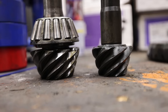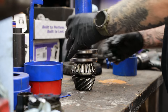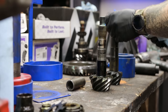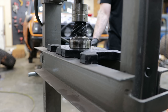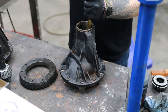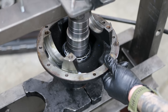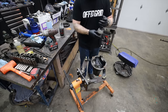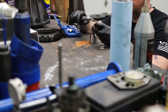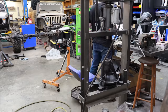The first step to installing a fresh ring and pinion is installing a shim either behind the race or we can reuse the factory shim behind the bearing on the pinion itself. Using a pinion bearing puller, I'm going to pull this bearing off, pull the factory shim out, and place it onto our brand new pinion. It took a lot of extra force to get this bearing pressed on, but it's on there. Next step is driving our new races into the third member. I've recently found it's much easier to use a press than a traditional race driver, which is a little less labor intensive. Then we need to get in the ballpark of our pinion preload — things just need to be dragging a little bit.